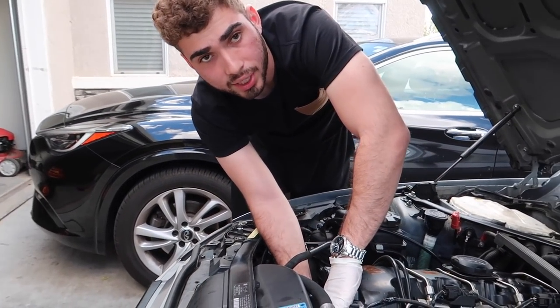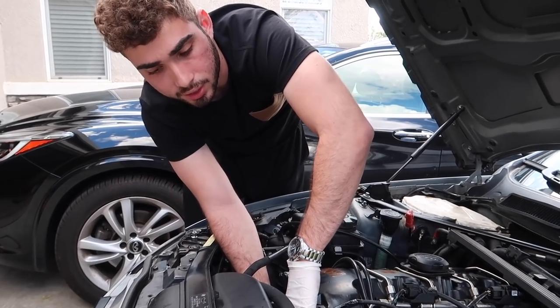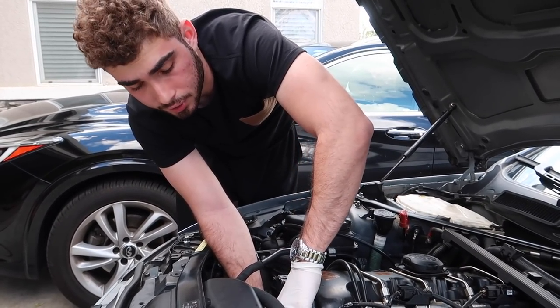Alright guys, it's a new gasket. This thing went in so nicely, so hopefully it just needed some new gaskets and a new sensor, and that should fix your two codes. We're about to find out. Moment of truth. So there's an exhaust camshaft sensor and then there's the upper camshaft sensor — they're paired together. We replaced both of them. The one on top had a pretty snug fitment, so I'm pretty happy with that. The one on the bottom did not have a snug fitment at all — we used a bigger gasket, so I don't know what's going on with that. But regardless, that is an issue. Let's take it out for a test drive.